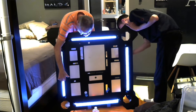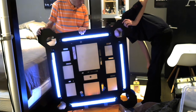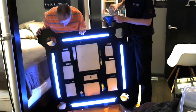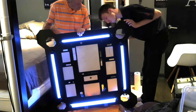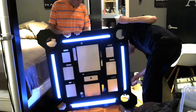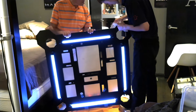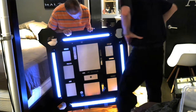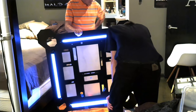Now you can't actually see the oil moving because of its viscosity and the fact that the entire loop is filled. But in the future I may put an additive or something that allows one to actually see the movement. Now if I had water in it, like we had in the test that we did in the garage, one could clearly see it moving. But I chose mineral oil because it doesn't conduct electricity and it doesn't really become gross over time like water does. But once we were done, we capped the loop and moved on to the next part.